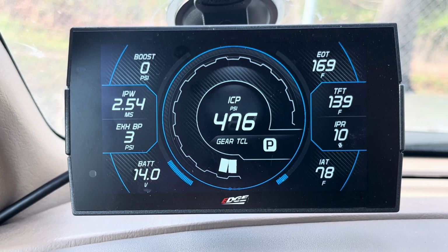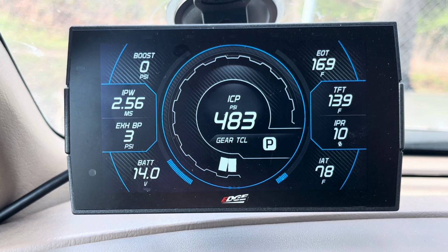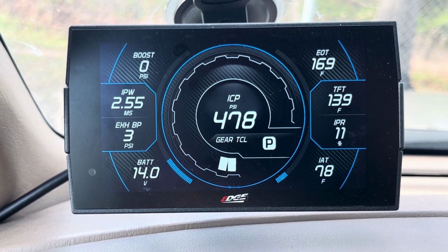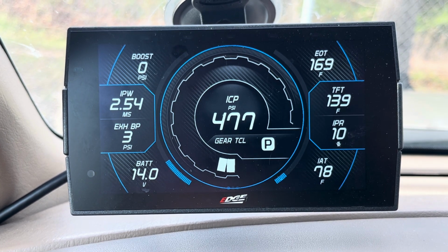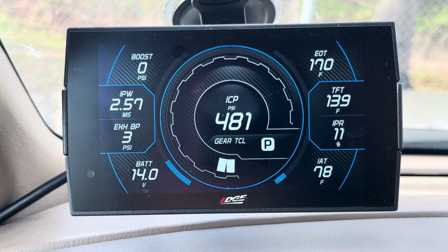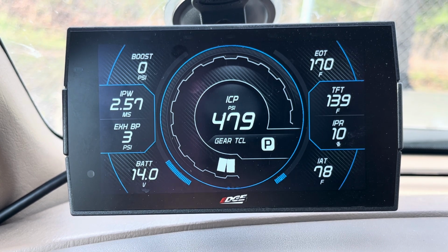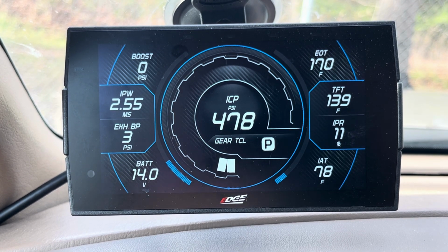My truck personally, I have a gauge off of the port at the fuel filter housing, and mine runs at 70 PSI. I've got an aftermarket spring in it. Most guys will tell you about 65 is a sweet spot. Really important to know, even if you can't monitor while you're driving, it's good to know. Even if you can just see what it is at idle or at free rev, it's a good thing to have. So that's one thing that the CTS cannot see.